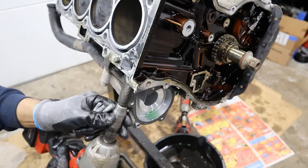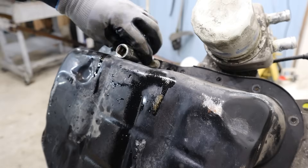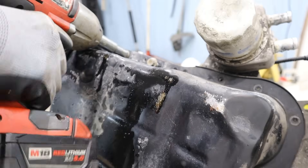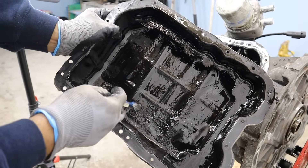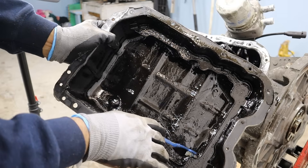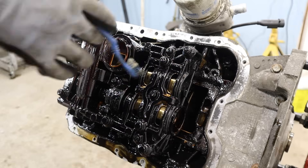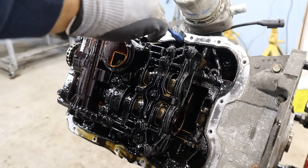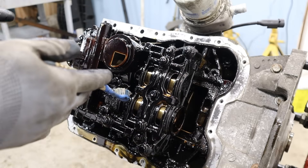One thing I forgot was this water pump housing — just a bunch of 12mm bolts holding it to the block. Here we have a stamped steel lower oil pan, which is nice and old school. There are two 12mm bolts holding the lower oil pan to the upper oil pan and the block. Oh no — the bottom of the engine isn't any better than the top. Take a look at all the crust and sludge inside here — this is nasty. It definitely indicates someone was not changing the oil frequently enough. Manufacturers' suggested oil change intervals are not enough. And if you look closely, you can actually see sparkles in there, so I'm pretty sure some bearing has been chewed up.